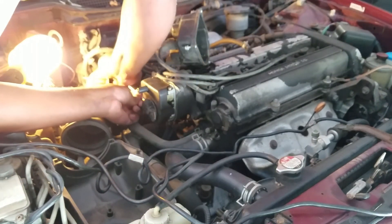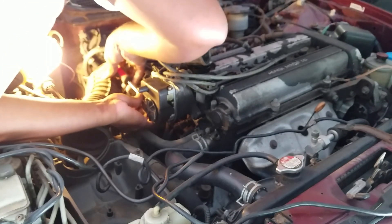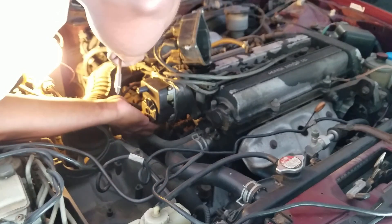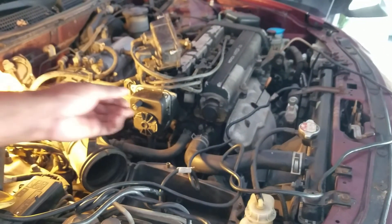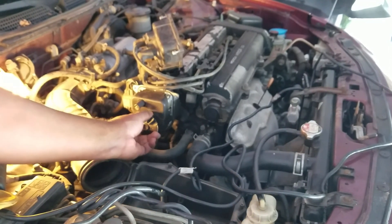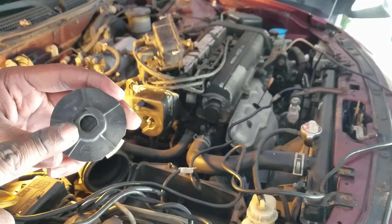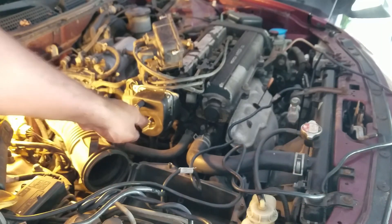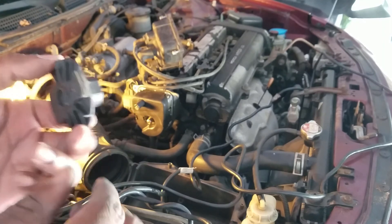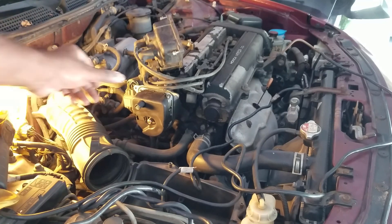That screw broke free — good. It fell right in my hand. So technically this rotor should just slide right out. And there it is — it slides out. There's a groove right here so it can't be placed in the wrong direction. You can see the flat end here and there's a flat end on the shaft as well, so it's basically impossible to put this in the wrong timing position. I also took off the dust shield that was right there — just pry it out and pull it off.